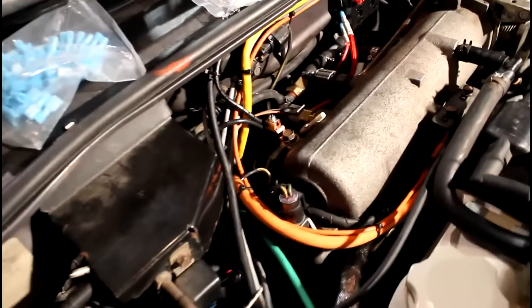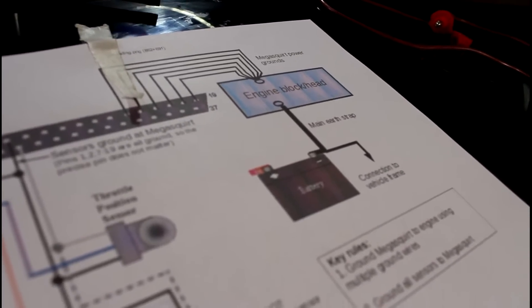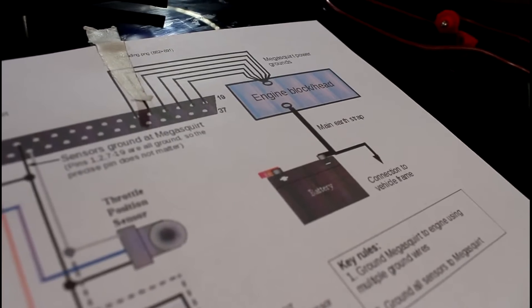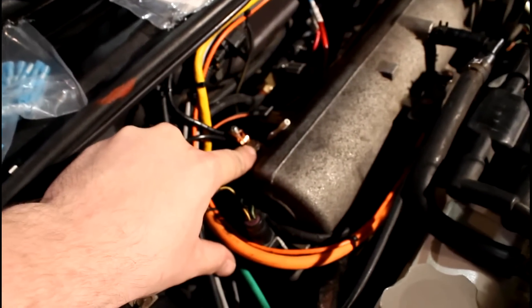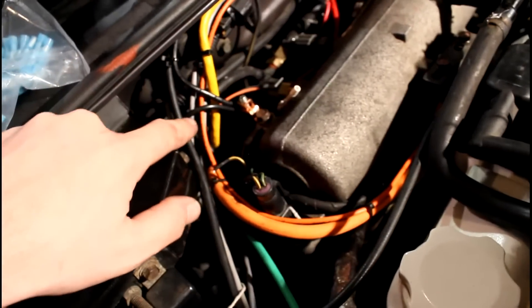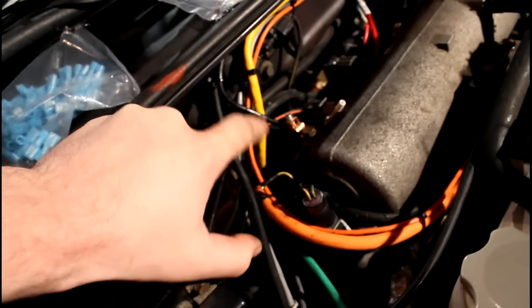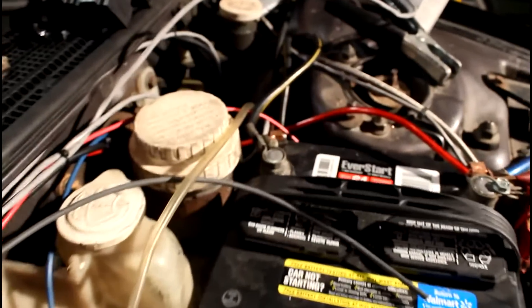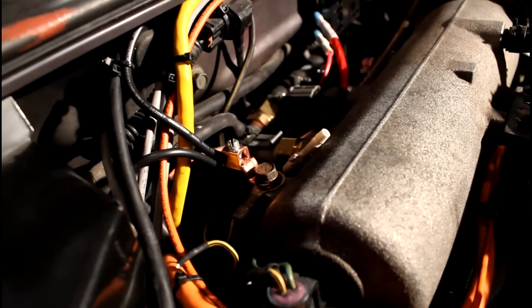As far as the actual grounding on the system, this guide up here shows grounding to the engine block/head, and then letting the battery be grounded to that head. I sorta did that — I hope it's not going to cause me a problem. The Megasquirt ground, I've got a nice 10-gauge wire that goes into the car, specifically breaking out to a lot of those top pins, but this ground I also have run all the way over to the negative terminal on the battery. So it should have a nice ground that's very close to battery negative.